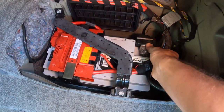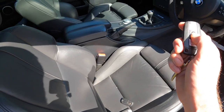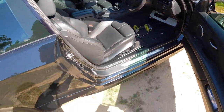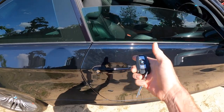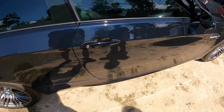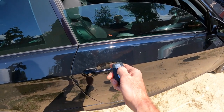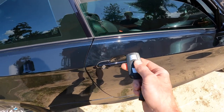The CAS module is just plugged back in. Let's give the car power. We have the original key. The original key works — we didn't break anything. I ended up doing a comfort key and a non-comfort key. This is the comfort key — it does not work. This is the non-comfort — it also doesn't work. These are prepared as dealer keys so we may need to use them to start the engine.